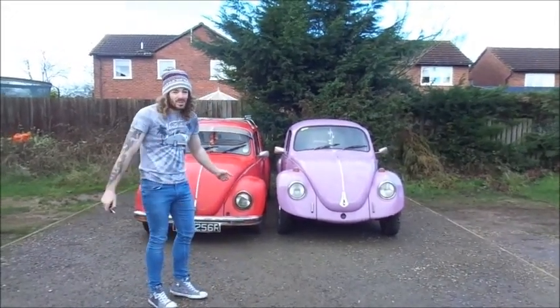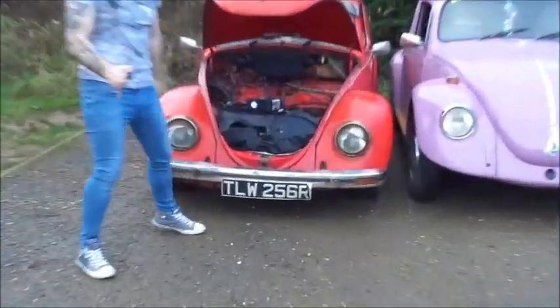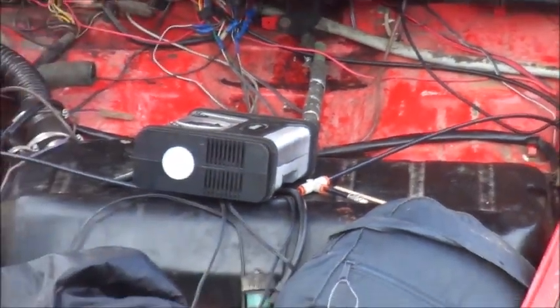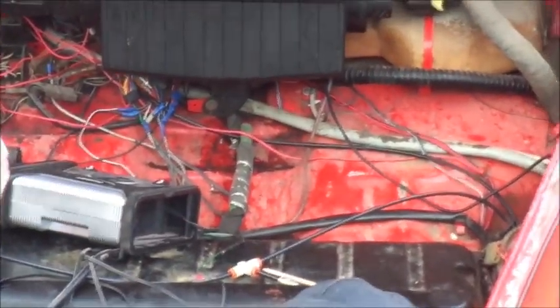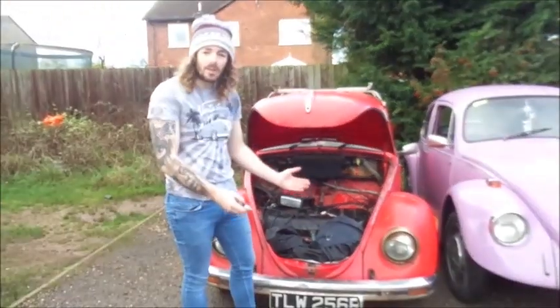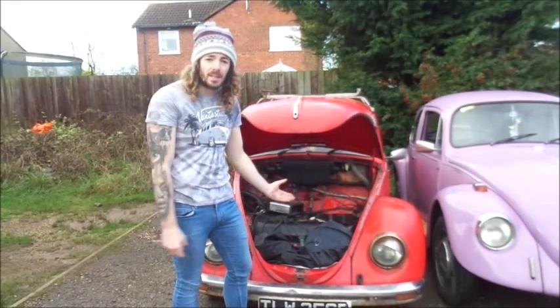Mine's on air suspension. I'm going to give you a demonstration. It's very basic air suspension at the moment. It consists of two air shocks and some free tubes. What the tubes do is replace the leaf springs — the torsion leaves — and that allows free movement up and down, so the air shock really controls the dampening and the height.